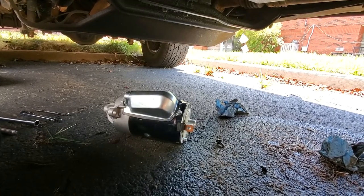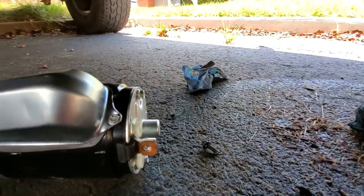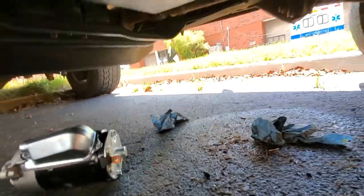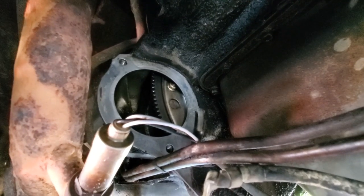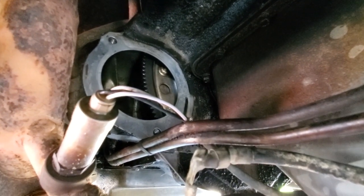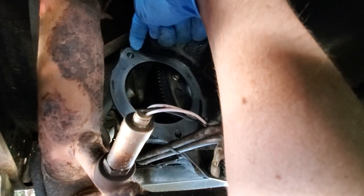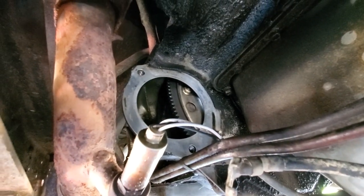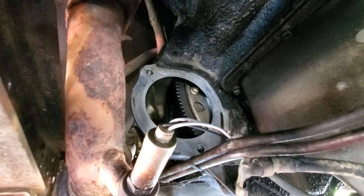I've got my new starter ready to go. You can see it came with its own electrical cable mounting bolt, so I'm going to use the new one. They've cleaned up the mating surface there a little bit and we're ready to raise it back up into position. The installation is just going to be the exact opposite of how we took it out — I'm going to hold it up into place and install the upper bolt first so it'll support the weight, then the lower bolt second, and reconnect the cable last.